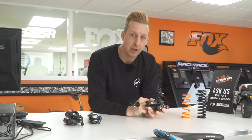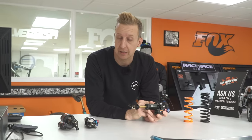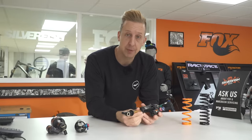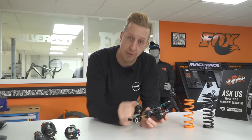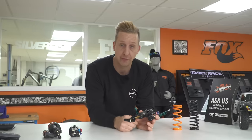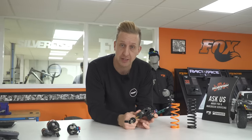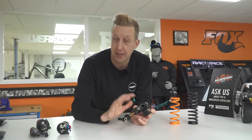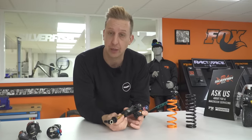At the beginning of the video, I said there are some performance benefits to be had from running a coil shock. What exactly are those? First up is that small bump sensitivity that everyone talks about with coil versus air. On an air shock, you have to overcome the force of the air spring in order for the shaft to start moving. Quite simply, the coil shock unit basically takes less effort to get that shaft moving. It's famous for having that small bump sensitivity, through the combination of less friction it has to overcome at the shaft and, of course, the actual movement of that coil spring.